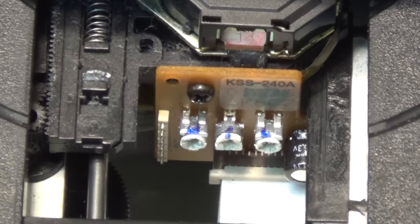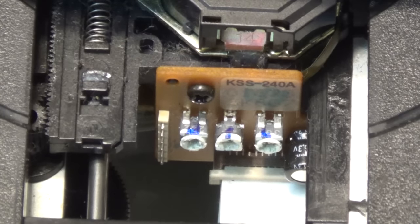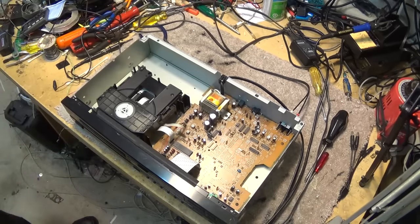It's a pretty reliable pickup. It's what they call a three-beam or three-spot pickup: you have your main beam focused on four detector diodes, and then there are two side spots for tracking. So this is what they call the three-beam laser pickup. Not sure what to expect here — let's try my damage defect disc.